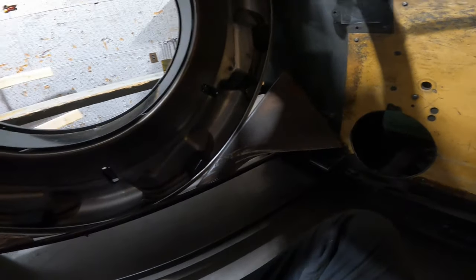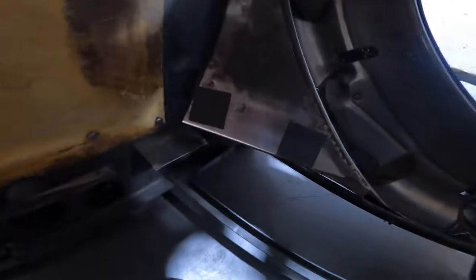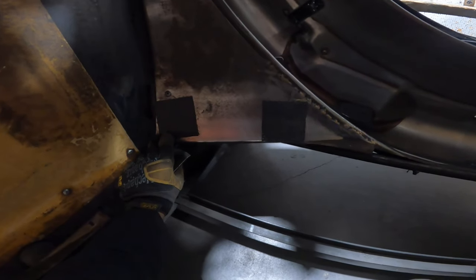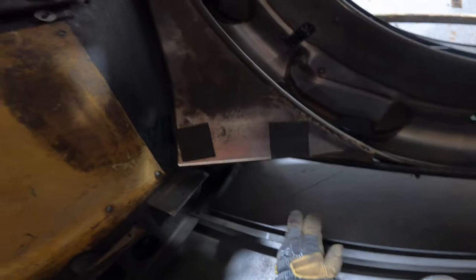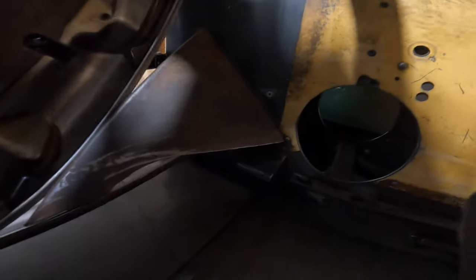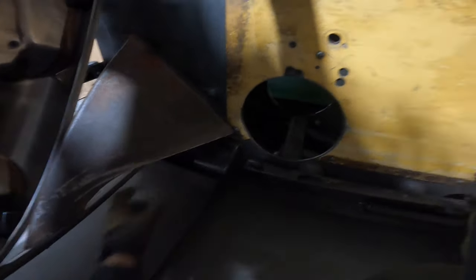Everything's out of the pit now so I'm going to clean it quickly to get the crap out of the way before working on the hinges and pit support brackets. Now is a really good time to inspect the plows. This one has a few cracks — I'll probably end up replacing it but don't have time today, so I threw a few pieces of old distributor belt on them for now. This other one has a bad bracket on the bottom but it's still solid.